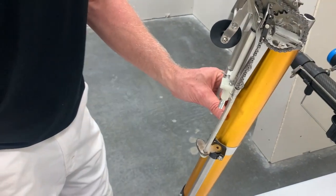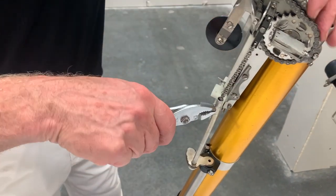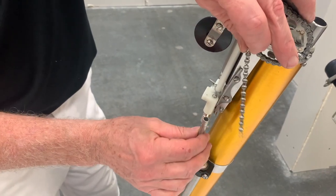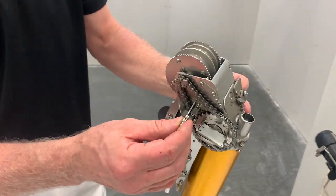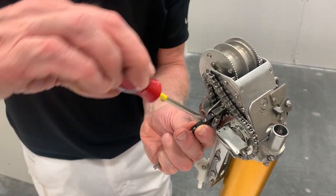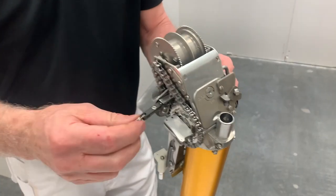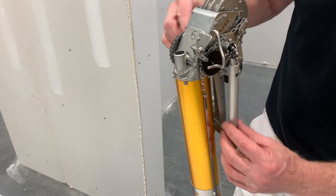On this other end, use a pair of pliers or needle nose pliers to pull out the other pieces of the broken cotter pin. The chain will come off — set this piece aside so you don't lose it. Then push the block in. Tighten up this screw just a little bit so it'll ride through the guide, and push it through.